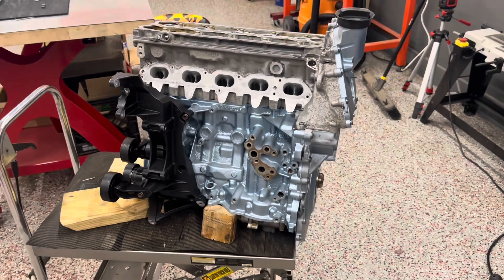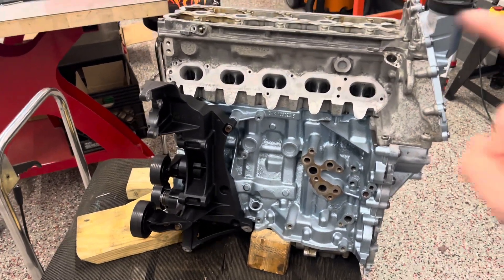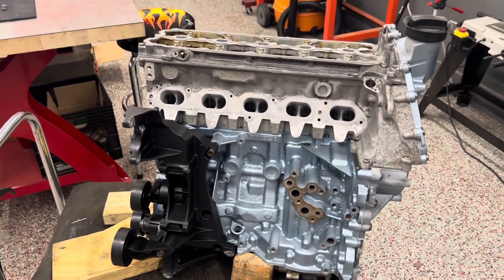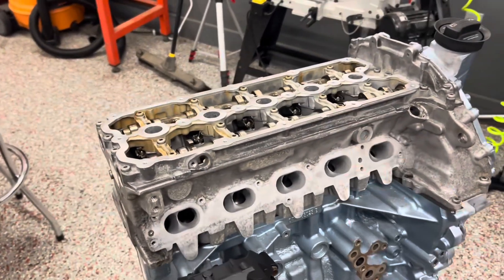The latest five-cylinder is the Audi one in the RS3, and that's still an iron block, but it's also turbocharged. So these engines come stock pretty okay for boost — you're not going to crack the block or anything by putting boost in it because of the iron. And it doesn't waste that much weight. The head is cast aluminum.